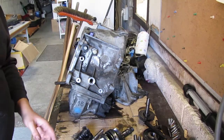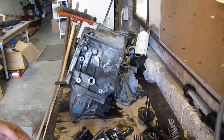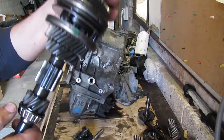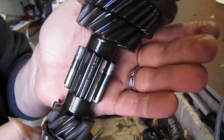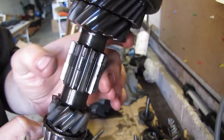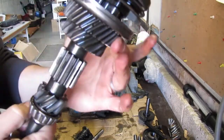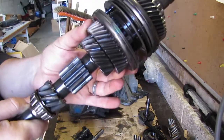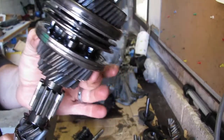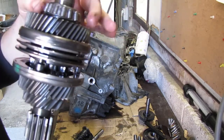I've also taken a little time to inspect some of the things that came out of the gearbox. The main thing I'm concerned about is this gear right here — you can see two chips on it, and I'm guessing that's not regular. Other than that, I believe there is a bearing behind this one with a little bit of play, but not enough to really go the extra mile of changing that bearing as well, though I do have it.